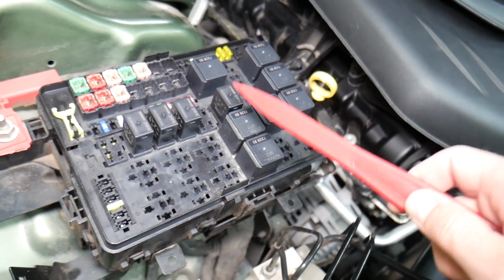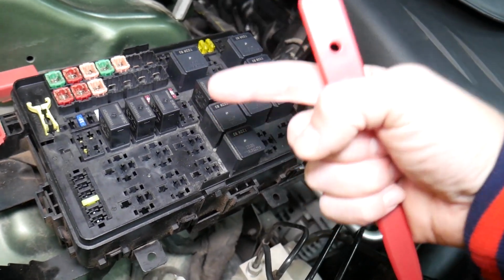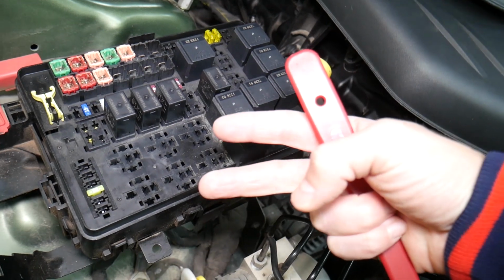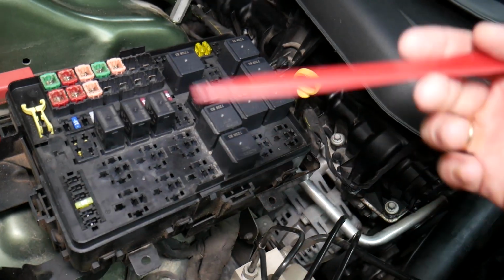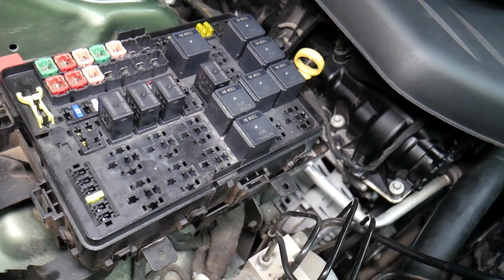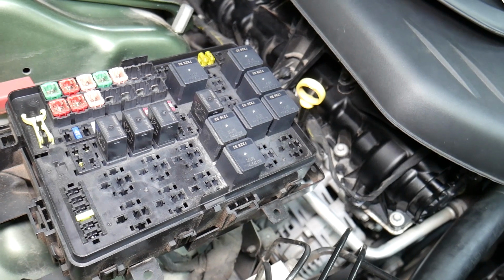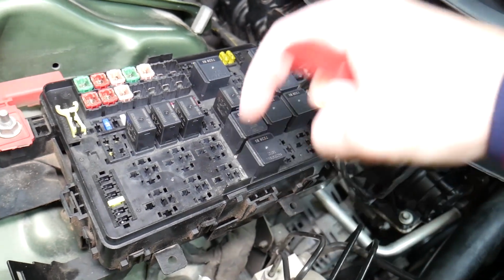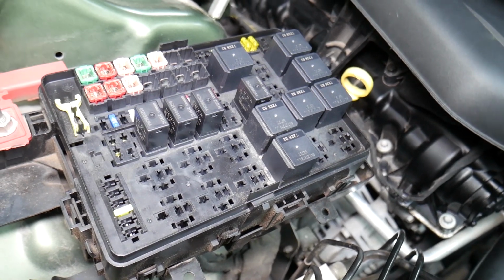But when disconnecting the car battery, a common mistake people make, it's important to know which battery terminal you reconnect first. If you do it the wrong way, you can burn electronics modules. How do we know about that? We burned before the traction control module on a BMW that cost us $2,000. So we'll put a link in the description of the video below on which battery terminal to disconnect first. Check it out for your convenience.